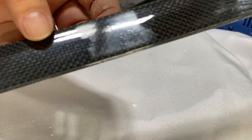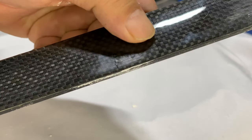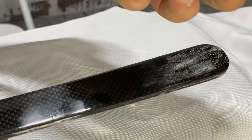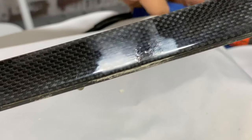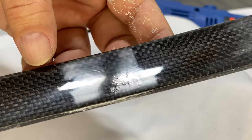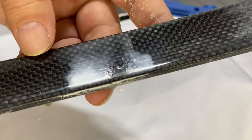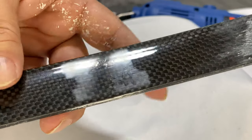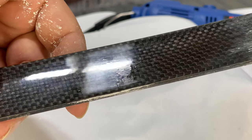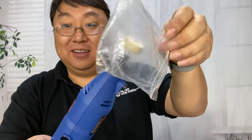All right guys, it did a pretty nice job of polishing. You can see I still have some polish marks, but it got rid of most of the big stuff. I can still see a little bit of it, so I'm going to finish up with a finer polish — but I'm actually pretty impressed. I was only doing this on about speed three, so there's a lot more speed I could crank into it. I'm probably going to use a circular pattern and switch to a polishing compound rather than rubbing compound — I think that'll give it a nice shine. It's going to be an easy way to correct this without taking it to a professional. If you're using a compound like this it does splatter a little, and especially if you're grinding, use eye protection and stay safe. Really happy with this tool — it is powerful and it's great. If you want to pick it up, I'll put a link in the description below. Peter Von Panda, out.